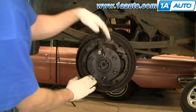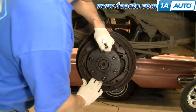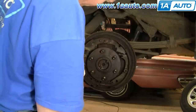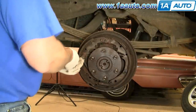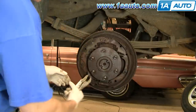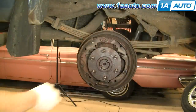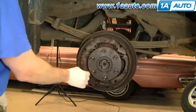Go in here and then grab your adjusting lever. Pull it out and down. Next, this spring right here — just grab onto the first coil, pull it down and out. Now you can remove the little spring for the adjuster lever.